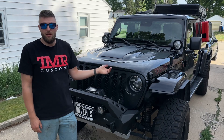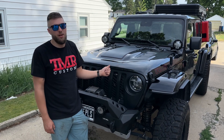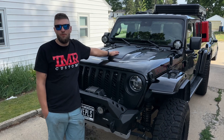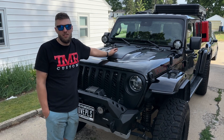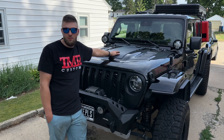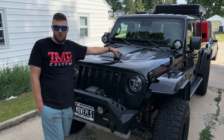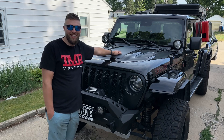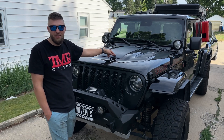Now that the install is complete, I should be able to run different accessories without my battery being drained during the day. The main reason for this was my 12 volt fridge that I'm going to be running in the back — while I'm overlanding, the battery will be getting charged while driving, and once I park and set up camp before dark, this will keep my battery topped off. Once it gets dark, the fridge shouldn't be running as much because it'll be cooler out, and if the battery ends up dying overnight, once the sun comes up it'll charge it enough to start the vehicle. Super straightforward install — the hardest part is probably just aligning the solar panel on the hood to make sure it's not crooked. If you want to check these guys out, I'll leave a link in the description along with links for the adhesive tape and all that.